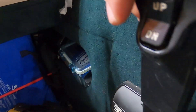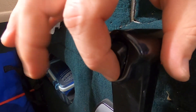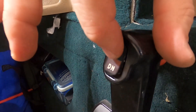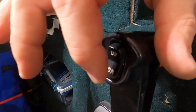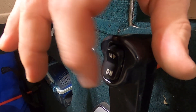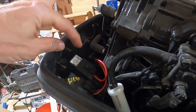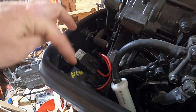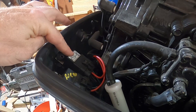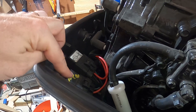Up here at my trim switch — you'll hear it click on the downside. It'll go up. See, now it's going down, so it was intermittent. Going back up — there, it won't go. That's the existing setup with the original relays. This is the down relay, this is the up relay. I replaced the down and the problem persisted, so now I'm going to replace the up relay and fix the problem.